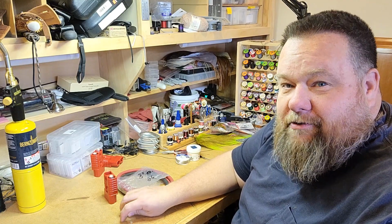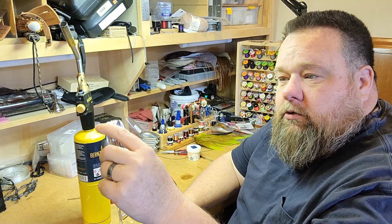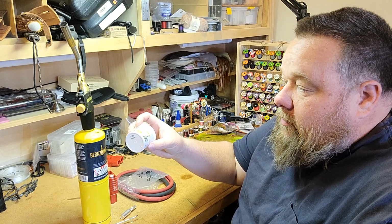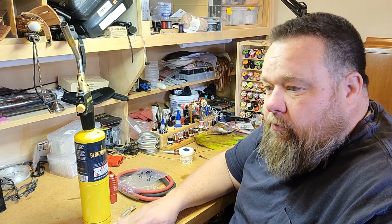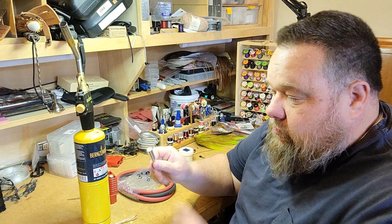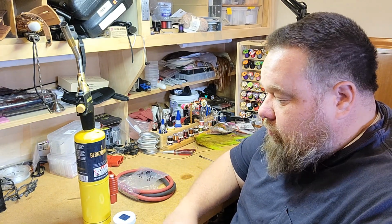We're not going to use a soldering iron or your standard solder. We've got our butane torch, and we're going to use the solid core solder that you'd use for soldering pipes. There's no reason to use your small rosin core solder for this. We do have the flux in a can, which will flux what needs to be, and we won't have a problem with too much flux. I have done these in the past with the small rosin core stuff that you'd use for electronics or wiring, and what you end up with is a big molten pool of flux on top with the solder underneath, and it makes a mess and is just not very convenient. So I'd much prefer to do it with plumbing solder and the paste here as opposed to using flux core solder.